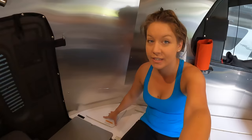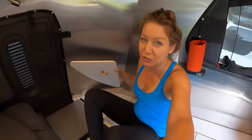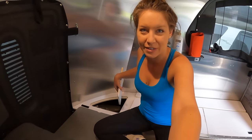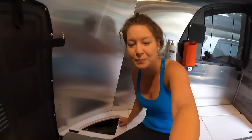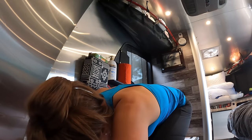This next maintenance item is new to me because I read my owner's manual for the first time in a long time. There is a strainer on the water pump which is in this little cubby, and you have to pull the strainer off and clean it. I don't see any water leak or debris — they really don't make getting to this stuff easy.